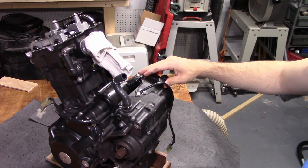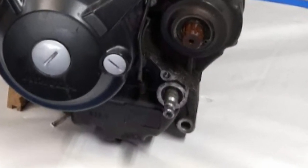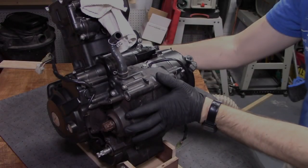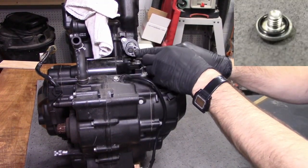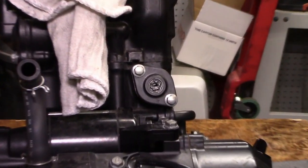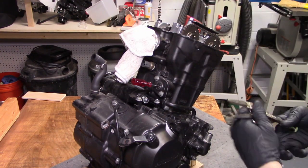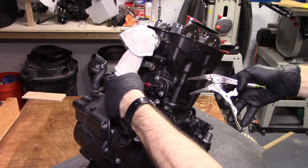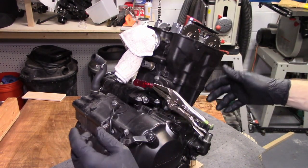You can do this by pulling on the clutch and using pliers to rotate the gear shifter up or down as needed. With the piston at top dead center, we can now remove the cam chain tensioner lifter plug and O-ring. This gives access to a little flathead feature that puts tension on the timing chain. We need to turn this all the way clockwise to release the tension on the chain. Do this with a very small flathead screwdriver and hold it in place with a vise grip.